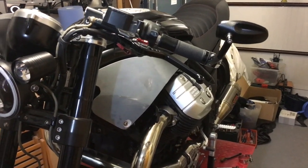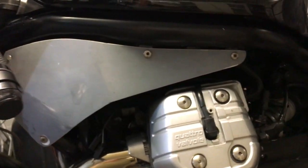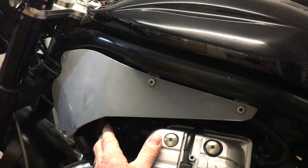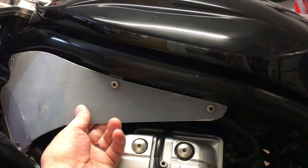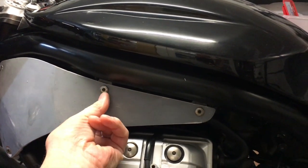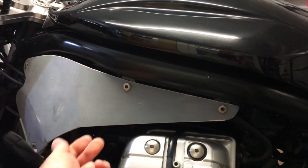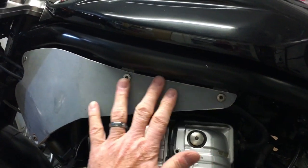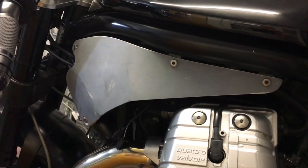So there's the first engine cowling fitted. As you can see, I've shortened it from sort of here back to here, and the 4 fixings are on nice and tight, and it's very solid. It's rubber mounted, and it uses some bolts which have some sort of longer shank, so it's tight, but it's not tight onto the fiberglass. So reasonably pleased with that. That's going to go black, probably gloss black with a clear coat over it, and I've just got to do the other one now.